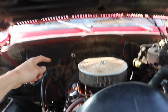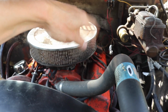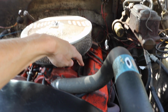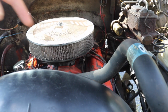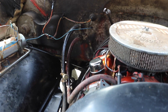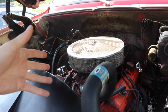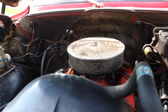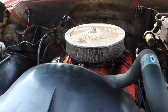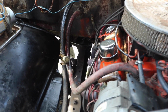So that's awesome. About 15 years ago, or 10,000 miles ago, when I first got it, some of the rocker arm lock nuts came loose. It was on this side. So I'd take the valve covers off then, tighten them, and then I ended up replacing 1 or 2 of those lock nuts because they just wouldn't lock anymore. Then about 2 months ago, or 2,000 miles ago, I took both valve covers off and I adjusted all of the valves. So that's the last thing I did with this, and I replaced the gaskets, and now we got a problem.